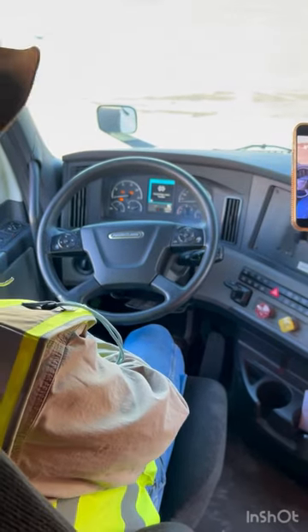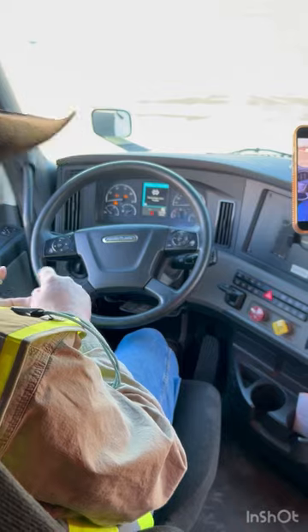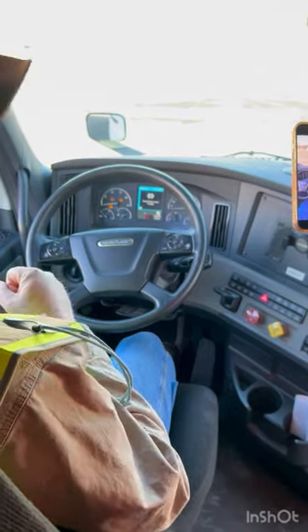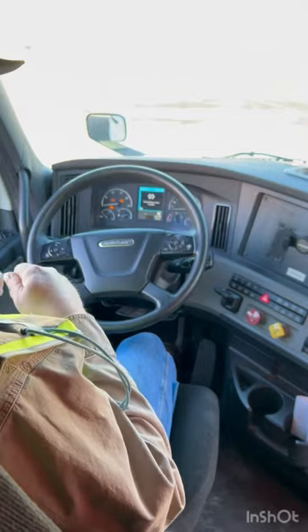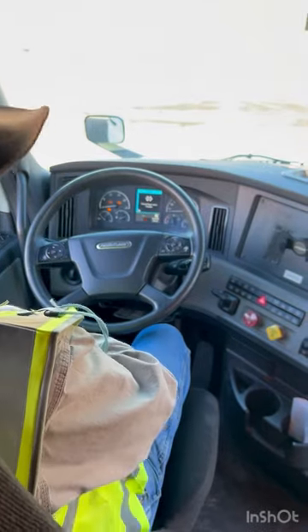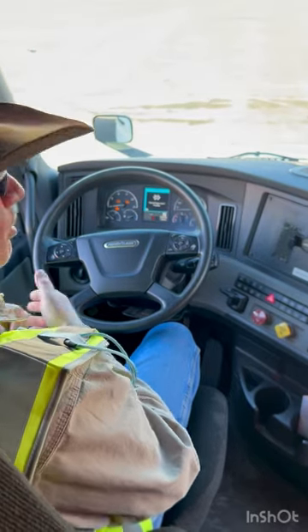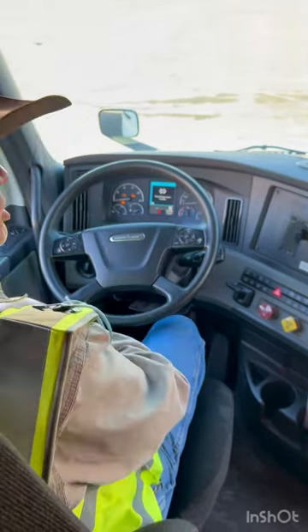For the sake of the video, we'll count it down — 20, 30, 40, 50, 60. We're at 10 seconds. Wait for them to tell you. You may continue. Now I'm going to fan my brakes down to 55 PSI, at which point both the red light and buzzer should come on. My buzzer and light have come on. Very good.